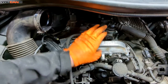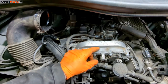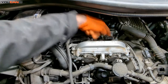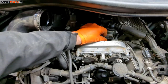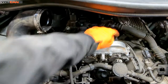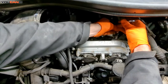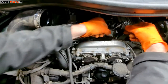All of these sensors are reading for the cam and timing and so forth. If we need to remove and replace this one, we first want to undo the electrical connection — pulling that little white tab back, squeezing the connection, and then unplugging it. Then we need a T30 to undo that bolt. With our T30, we loosen and remove the bolt that holds the sensor into place.